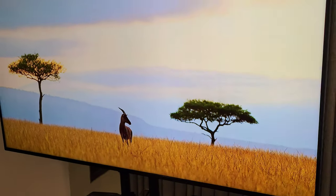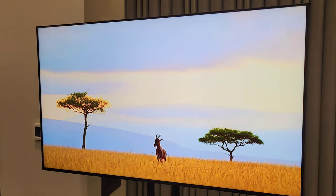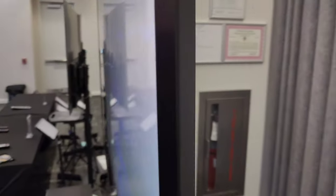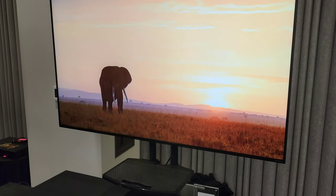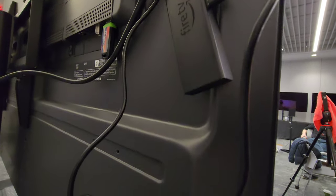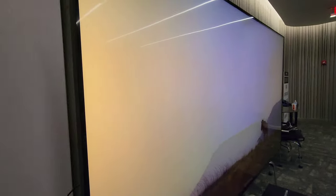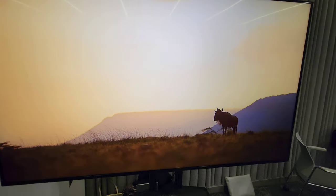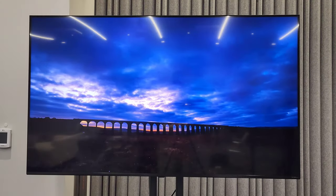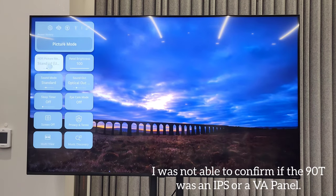All right, LG QNED 90T — mini LED, 65 inches. Quick look at the build quality and design: it is mini LED so it's a little more thick than a direct-lit or edge-lit. You have four HDMI 2.1, 120Hz panel, FreeSync Premium gaming. This is the top of the QNED lineup. Below it are the 80 at 60Hz and the 85 upgraded to 120Hz. The 90 is the entry to mini LED, then there's an 8K 99, and a massive 98-inch 89T — the 89T is not mini LED but does have precision dimming. This QNED 90 also has precision dimming, and the local dimming is excellent.